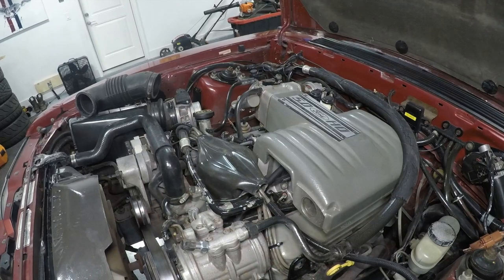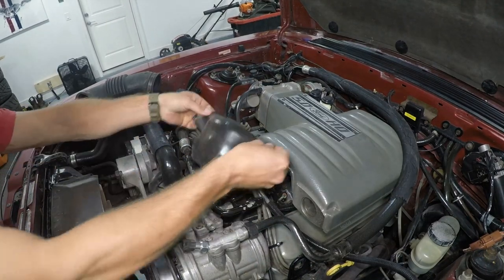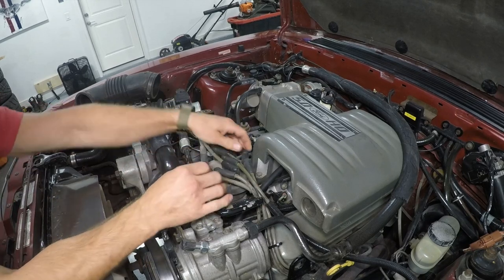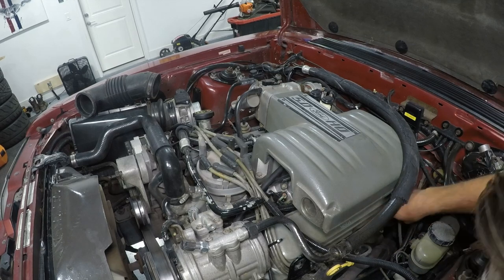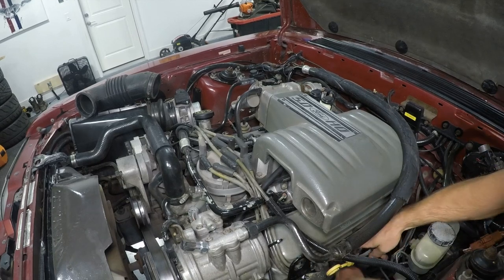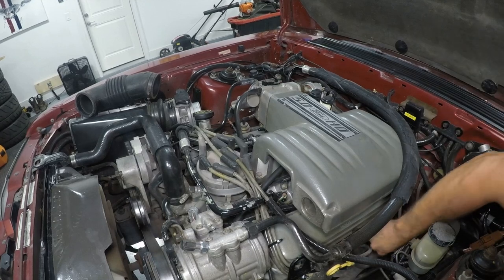I'm going to speed the video up here so I don't bore you to death. What I'm doing is just removing the dust cover boot from the distributor — probably most of your cars out there already have that thrown away. Then I've released the clips off both sides of the distributor cap. Now you can see me reaching in the motor here — all I'm doing is pulling the plug wires off of the plugs, not really pulling them off in any particular order.